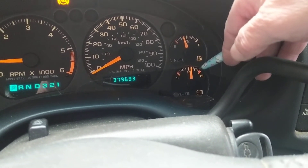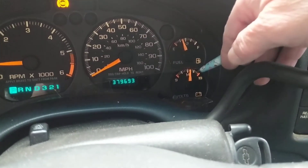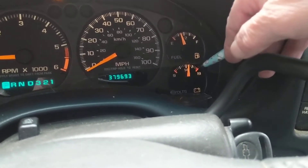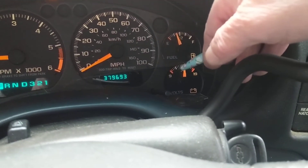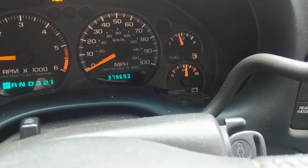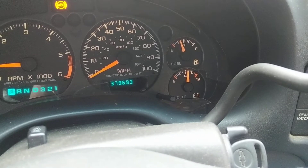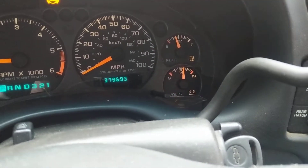Below 32 degrees, you can pay attention to that — as long as it goes down, the temperature compensation circuit is working correctly. Now if the gauge is somewhere around 11 volts, you know right off the bat — you don't even need a multimeter — that the battery has been drained for whatever reason. That's the indication of that gauge.